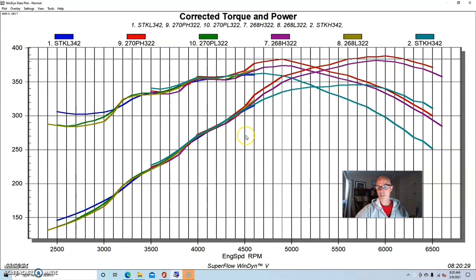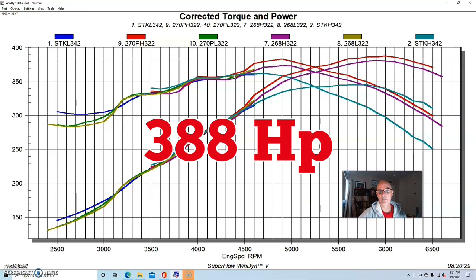Just like the PI versus non-PI comparison on the 262 cams, comparing the non-PI 268 cam to the PI 270 cam shows that the PI cams make more power. They have more lift - 550 versus 500 - and make more power from about 4500 on out. They did lose a little power down low, though maybe slightly less than the non-PI version. Their sine wave pattern seems to want to be equal to or above the stock curve, making the PI cam a better choice on this combination.